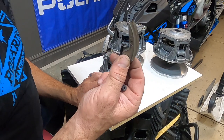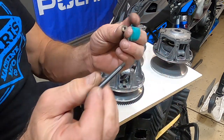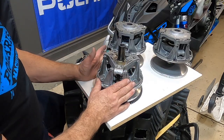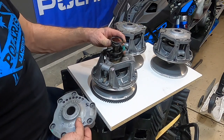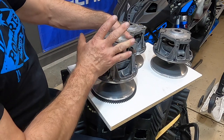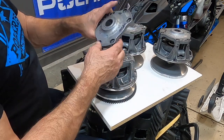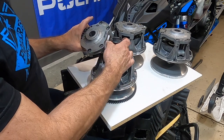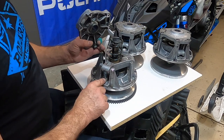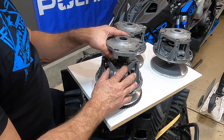This weight is pretty easy to get to — it's just got this bolt with an Allen head on one end and a little nut on the other. This is a pretty easy clutch to take apart. There's a spring in this clutch that goes right here with a cover. It's spring loaded, so be careful when you take this apart — don't let it spring back and hit you in the head. There's a clutch compressor you can use, which I highly recommend. You can even do this — replacing, cleaning, or checking these weights — with the clutch on the machine without having to pull it off.